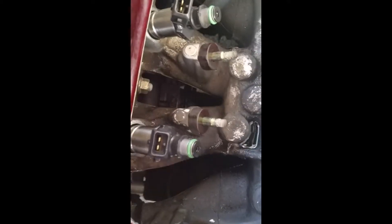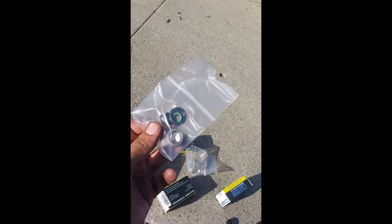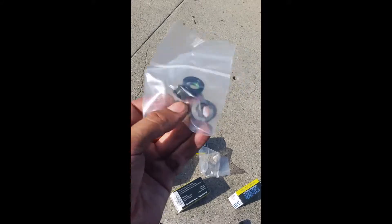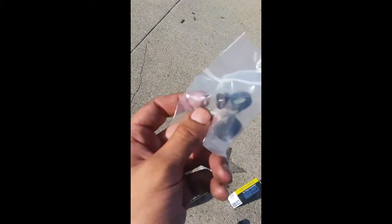Got the new ones in — I got them pretty much exactly where they were before, just straight up basically. I really cleaned all the little grooves well and then just took a smear of oil with my finger and put a film around the ring at the bottom — the cushion — and the green ring at the top. This was a bushing set from JB, but I didn't need it because the injectors already came with everything I needed. It's a set for two different types of injectors — California and nationwide vehicles, with two different O-rings for the end. I put those in in reverse order.